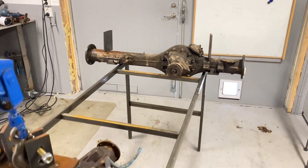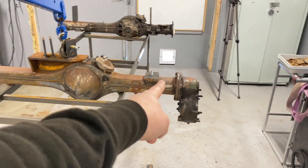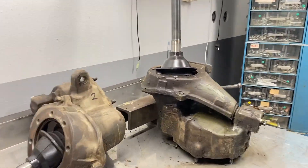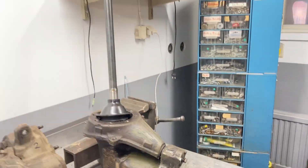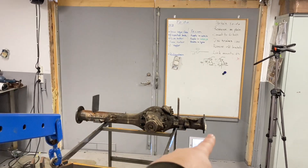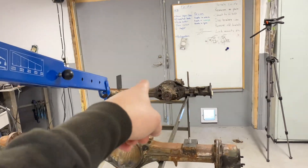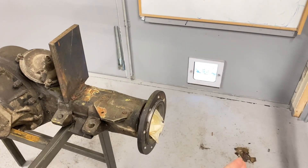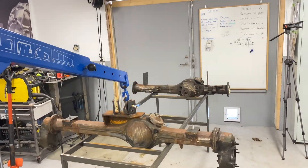Here's the key detail: the rear axle mounting flange distance is wider than the front axle, because on the front you have the steering knuckles. The distance from the mounting surface to the wheel mounting surface is wider — meaning the front axle housing is actually shorter than the rear axle housing. By having different widths, you can put the wider steering knuckles on the front and still have the same wheel-to-wheel distance front and rear.